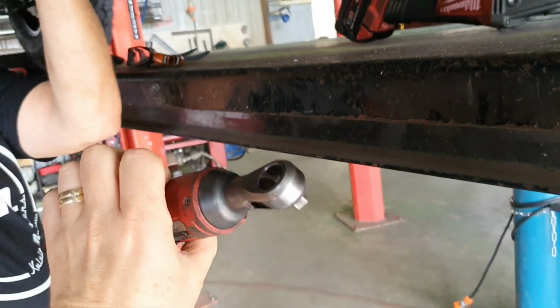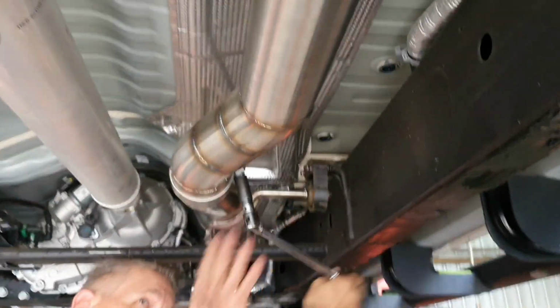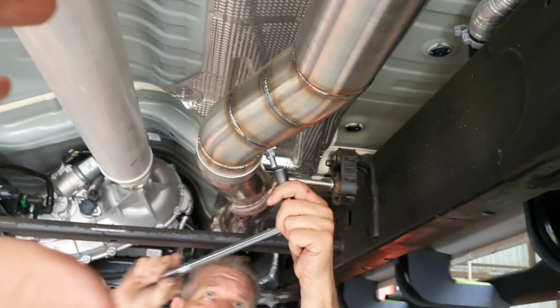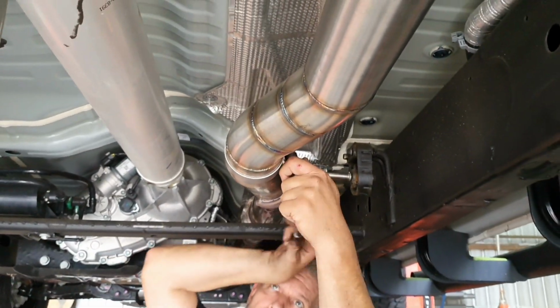You'd be amazed how much torque that ratchet head has. But you should definitely do them up with a breaker bar afterwards, just to make sure they seat, and probably check them about a week later just to make sure. Basically, we're just pulling a bunch of things together here, so a little bit of extra retensioning in a week's time goes a long way.